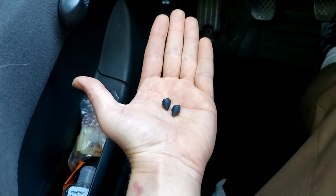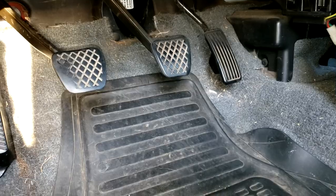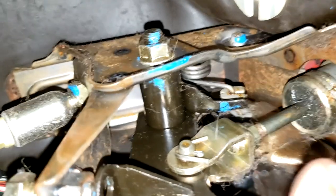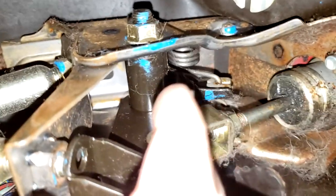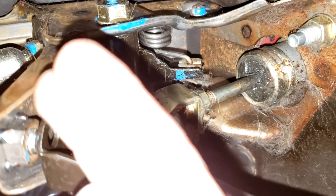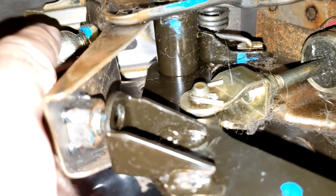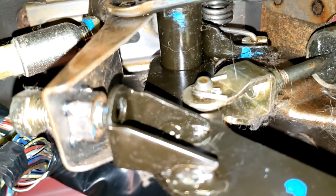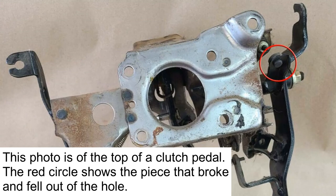When your brake light won't turn off you see people driving down the road — it's something like this. Let me show you a quick way to fix this. Getting up underneath the dash, here's the clutch pedal. Here's the top of the clutch pedal, and this cylinder right here is where the clutch pedal is bracketed in. At the top of that there's a little flange with a hole in it — as you push the pedal in, that flange moves back toward the driver. This is the clutch pedal switch with a little button sticking through there; when you press the clutch pedal it depresses that switch and then you can start it.